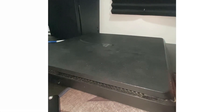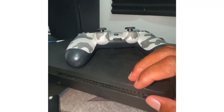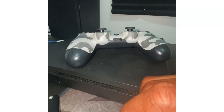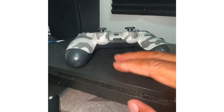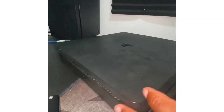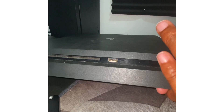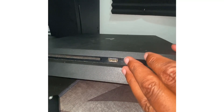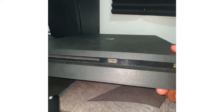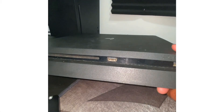When you plug it in, it's going to put you into safe mode. Make sure you have a controller because it's going to ask you to press a button. It's going to say no hardware found — that's when you need the PlayStation software downloaded onto a flash drive prior to doing this. Plug the flash drive in here; it's going to ask if you want to install the software from the external drive. Pick yes, it'll read it, boot everything up — it'll take maybe an hour or less.